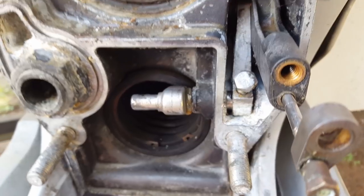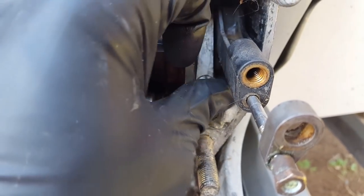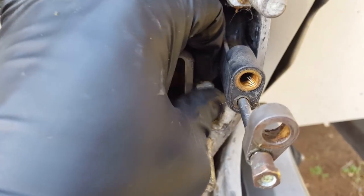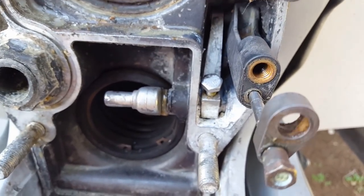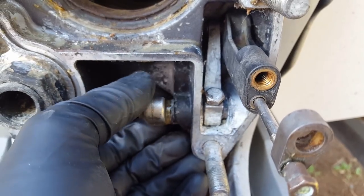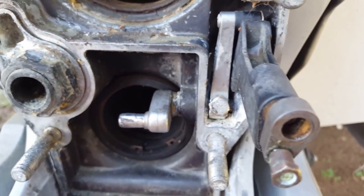You may need a screwdriver on this side to back up against the bell crank so it slides all the way in. Go ahead and hand-tighten this a little bit. Make sure you're inside that detent because you can potentially put this on at the wrong angle. Double-check you're in the right position, then tighten it just a little bit with the 7/16th — not too much.